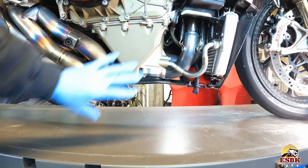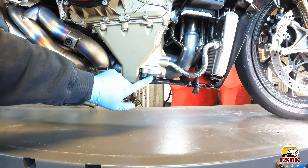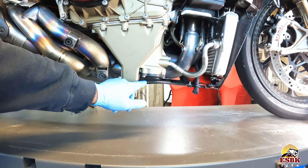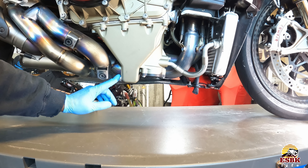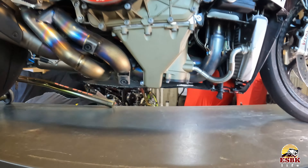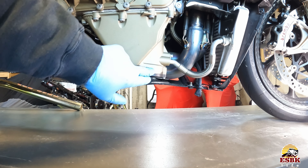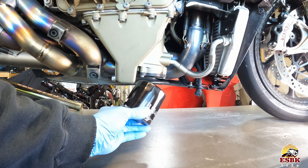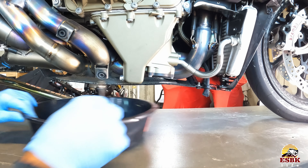Now that the right side lower fairing is removed, you can see we have our oil pan here, our drain plug here, and our oil filter housing with the cover. The housing cover is held on with three eight millimeter head bolts — the bolts themselves are not eight millimeter, but the heads of each bolt are in fact eight millimeter. We're going to get our shallow oil pan and put it under here. We're going to remove our 14 mil nut for the drain plug, and remove our oil fill cap to allow air in as we let the oil out so it drains properly. All V4 Panigales have an internal style oil filter — a cartridge style — as opposed to an external one like on the S1000RR and some other models.